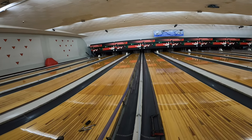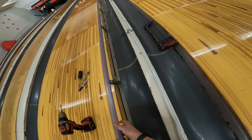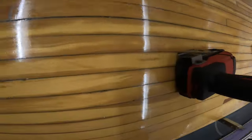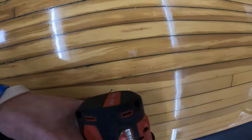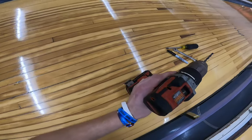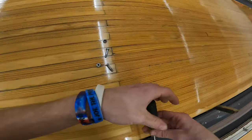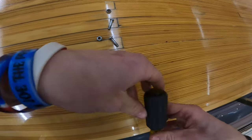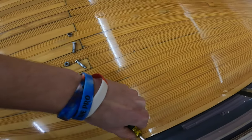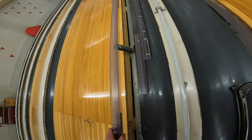Now that we have our holes drilled, go ahead and take our new section and lay it back in that bracket up there. Check the holes — they look pretty good, maybe just a little bit off, but we should be able to work with that. Go ahead and screw in. These don't have to be ridiculously tight — you want them snug but don't over-tighten them, because that might crack your plastic and then you'll have to do this all over again.